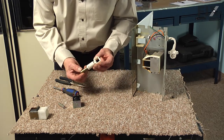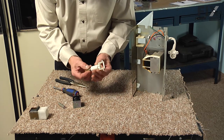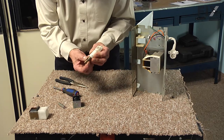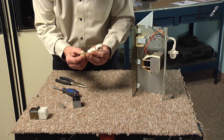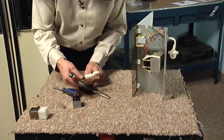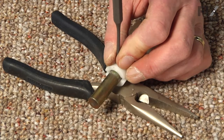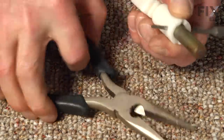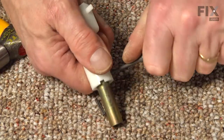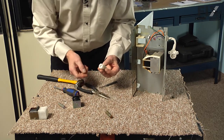Now with the old plunger assembly removed, you'll note that the metal part of that plunger is attached to a plastic extension, and we're going to reuse that plastic extension. It's held in place with a roll pin through that metal plunger, so we're going to have to remove that roll pin. We'll use our punch and our hammer to knock that out. We'll set that on a flat surface and support it. Once you've got that most of the way through, you should be able to pull it out with the pliers. Then just remove the punch and remove the old plunger and discard it.